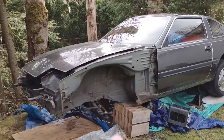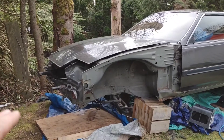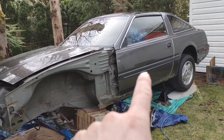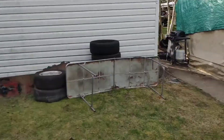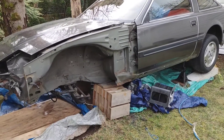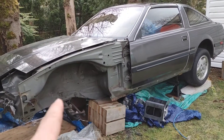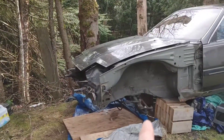Here's stripping parts. I got the whole front suspension set up off on both sides. The engine is all unhooked from up top here. I have the rear lifted now and everything out of the interior. The only thing I want to take is the door mechanisms and the dash to go into the red car, because I'm doing the great interior swap in that. That's the last thing to go in the red car. So I'm just gonna unhook the drive shaft, then kind of drop the tranny a little bit with the jack, set it on blocks, and then drop the engine and crossmember down in one. I kind of was thinking about hooking it up to here or something but I don't think that's gonna happen.